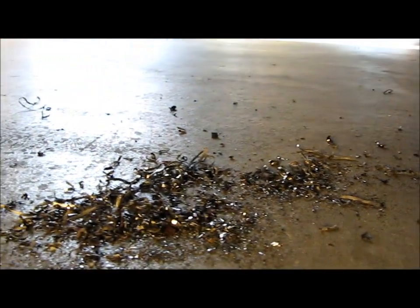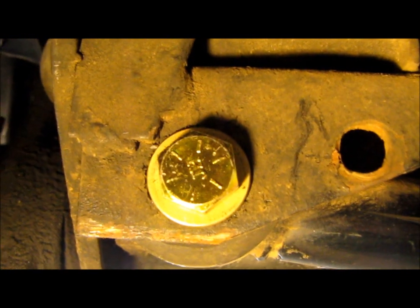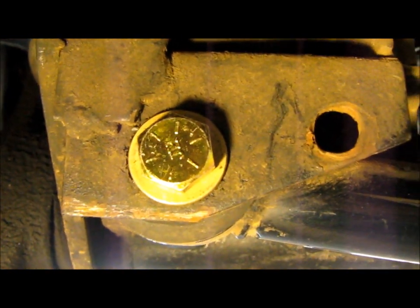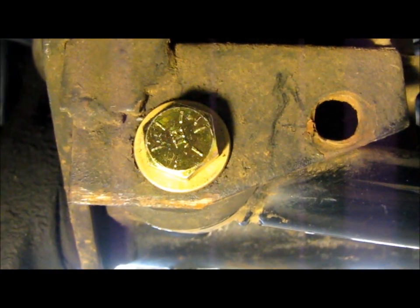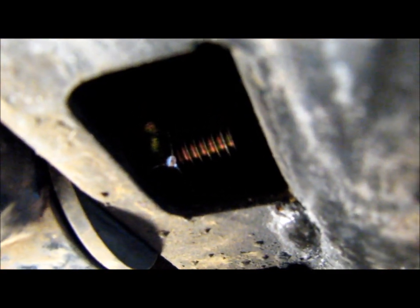You can see all my metal shavings down here — quite a lot of material was removed going through the sleeve. Once I was punched all the way through, I slid the half inch bolt in there making sure I had a grade 8 washer on the front and one on the back. Now one of the problems I ran into — there's the track bar, you can see the front's no problem. But the back, you don't have much room. You gotta go through this tiny little window on the back side of the mount.